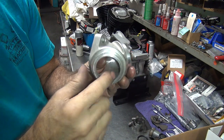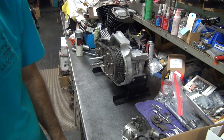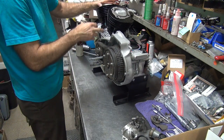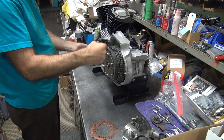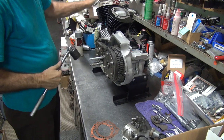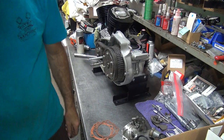What we have to do is line the heads up so this lines up — that'll make it seal better. If you don't have it lined up, it doesn't work very well. Right now it doesn't matter where we are on the stroke, but we are basically at top dead center — top dead center for the front. So we can adjust the valves on this one when we get to that point.